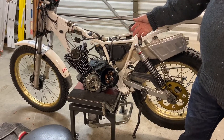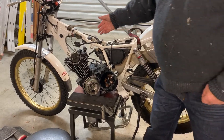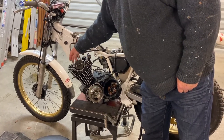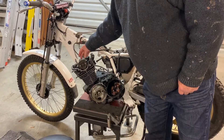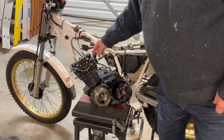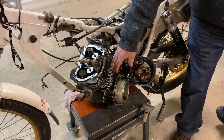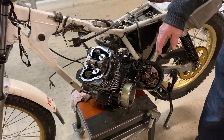So what we decided to do is work on both bikes and do the top end of both. Essentially what's happened is that the valves have been replaced on the inlet but not the exhaust, the camshafts have been reground on both bikes, and new pistons, rings, and gudgeon pins fitted, with the cylinders bored and honed on both bikes.